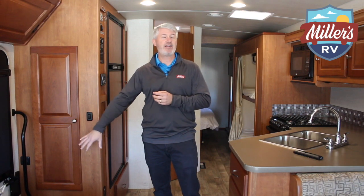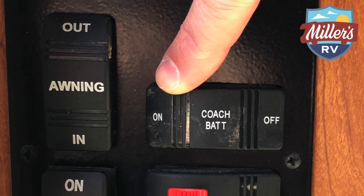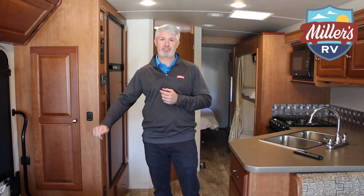The most common answer to this is a battery disconnect switch. In most motorhomes it's located right at the entry door when you come in. On some of the older ones it used to be located on the dash, but most of them it's right at the entry door. Sometimes it's a big switch outside in one of the compartments, but somewhere there's a battery disconnect switch in about 95% of motorhomes. If somebody — usually one of your little kids — has accidentally pressed a button they shouldn't have, that battery disconnect switch will turn off all your 12-volt power. So you'll come in and your lights won't come on, your generator won't crank, nothing will work. Always check that first, kick it on and you will probably have power.